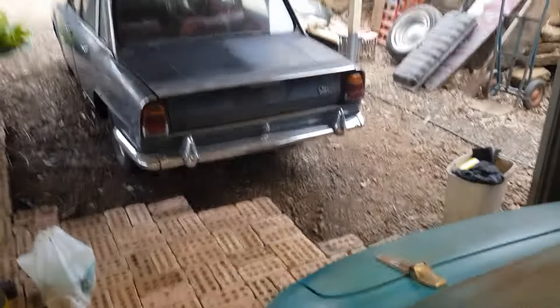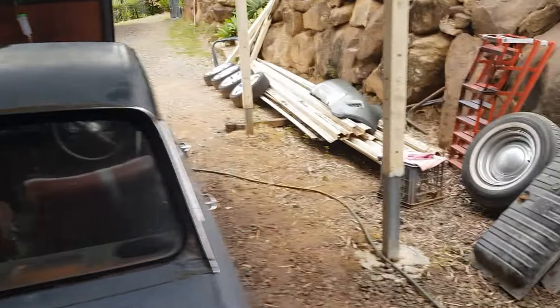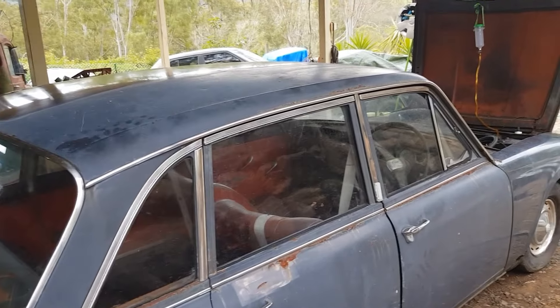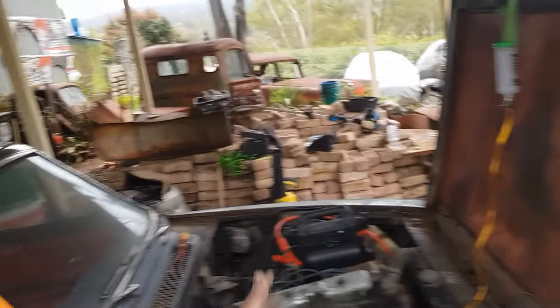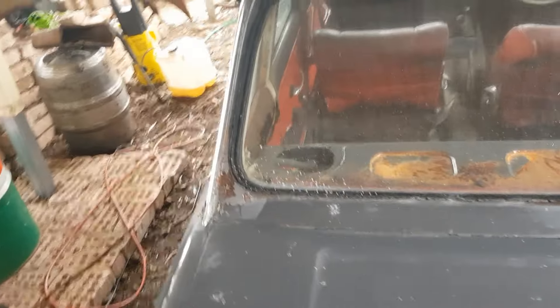I think by the time we put a battery in it and all that, we're a three grand build. We'll get it running and driving good, clean the interior, make it presentable, make it so it doesn't stink. We'll get it so it's watertight inside. We're not going to cut the floors out — not at this stage. We'll just fold up some tin, silicone it in through the floor holes, get some carpet in so it's watertight.